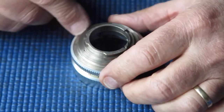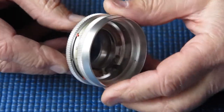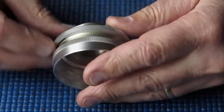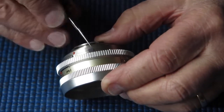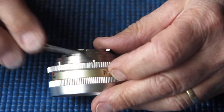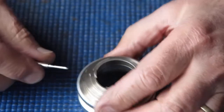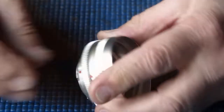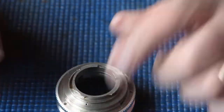That's the lever that opens and closes the diaphragm itself - that's fine. The other one shifts the aperture pointers. Two things I notice here: first it's stiff and doesn't return to the rest position. And here this tab is bent - you can see it's cocked off at an angle. That's been bent in some fashion, and that would almost certainly be contributing to the fact that this thing is reluctant to move correctly. I wouldn't be at all surprised if the ring it's fixed to isn't bent in some fashion. I've just squared it up a bit by pressing on it - let's see if it behaves any better. No, it's no better. So that's certainly going to be a problem.